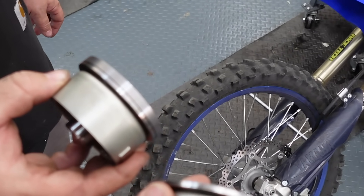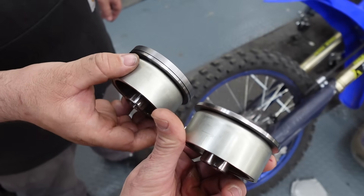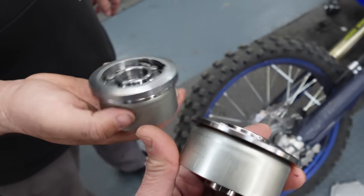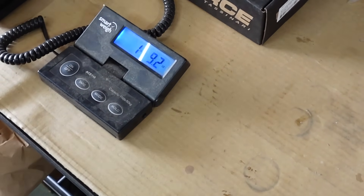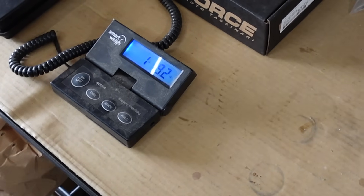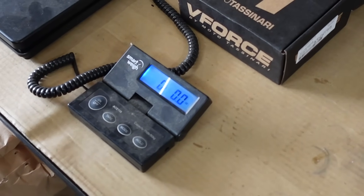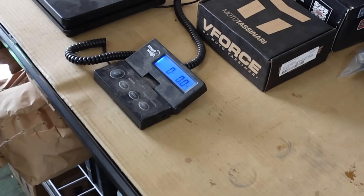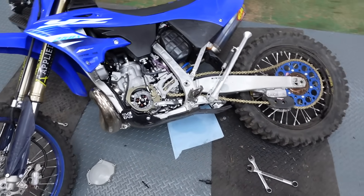We got this cut about perfect. In Tyler's hand it's GYTR — there's still a lot more weight there. We cut off basically the skirt around the edge. You can see the weight they add — this is the stock part and then there's the weight. Perfect cut. We're at 12.1 — we took almost three ounces off. So it would be about a four-ounce flywheel weight now. It took about almost half off. It's a give and take, right? Hydraulic clutch and a flywheel weight, or a lot of flywheel weight and no hydraulic clutch. We're just getting this dialed in for everyone.